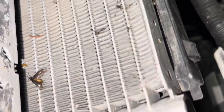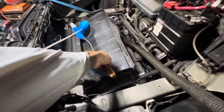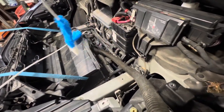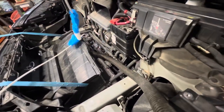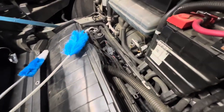Be very careful not to bend these fins. I've got the vacuum and these coil cleaners for refrigerators. I'm going to be very gentle — I'll vacuum everything I can and use these brushes like the dentist does: cleaning while running the suction at the same time — and hopefully vacuum up anything that's caught in there.